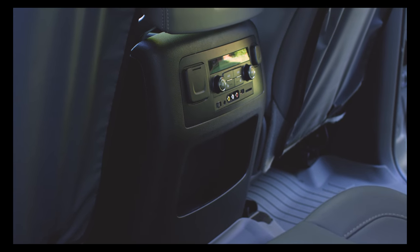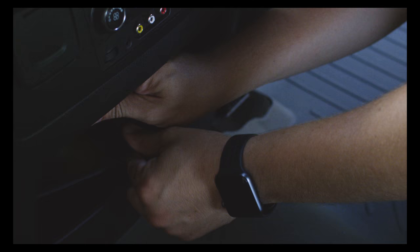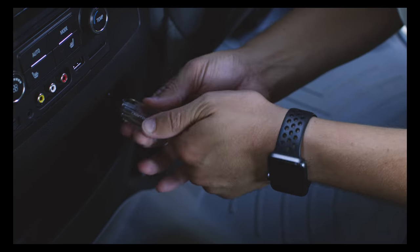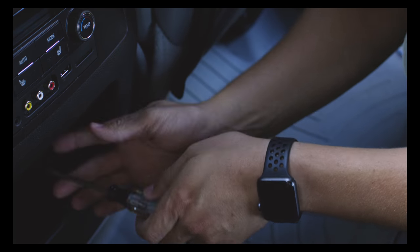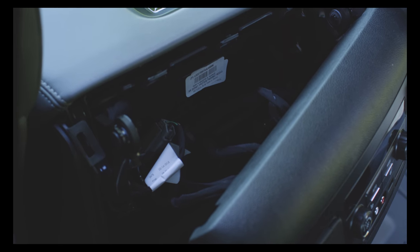In order to put the new harness in, we'll need to move to the back seat of the vehicle. For many of you, this console will contain the climate and media controls for the back seat. Let's remove the liner and the four T10 screws holding it in place. Remove this panel by pulling out and upward. Take note, there are several wires plugged into the back of the climate and media control panels — you don't want to pull too hard.